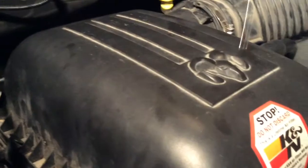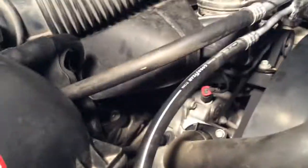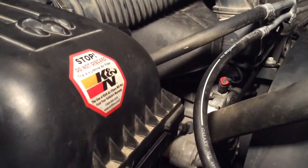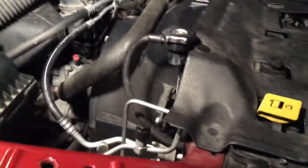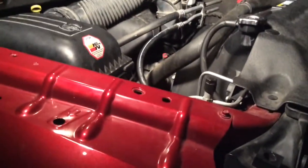When you're done, take your air filter and put it in a trash bag. When you're finished, just put it back in here — it's a lifetime air filter, so be gentle with it, then hook it back up. While you're working on it, stick a cloth down your carburetor to keep dust out, and put down two old blankets or towels, because your ribs are going to be dying the next day. It's not an easy job, but it's better than paying $300 to $400 — we probably spent $100 doing what they wanted $500 for.